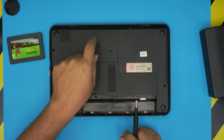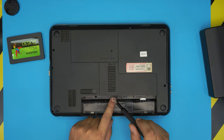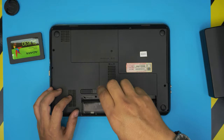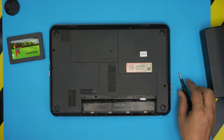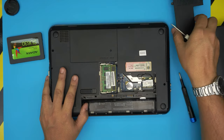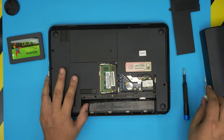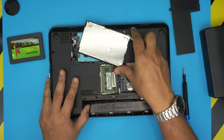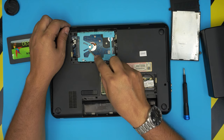We're going to remove this cover, but to get to it we first have to remove a smaller cover held by one screw. This screw won't come out entirely — it has a c-lock on it — so just give it about six or seven twists. Then use a flat screwdriver, put it right under the cover, and lift it up. Remove that cover, set it aside, then loosen the other screw, lift up both sides slightly, and the larger cover should pop open — there are small clips holding it.